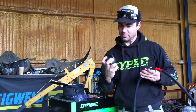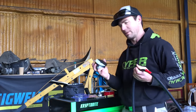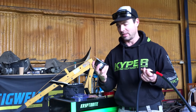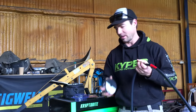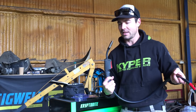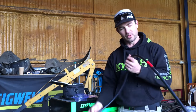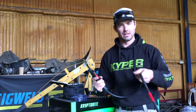I also ran out of wire, so I was using gasless wire and then I've gone back and bought some 0.6 - this is 0.8 and I've gone back and bought the 0.6 mild steel wire. In the process I've lost my 0.6 nozzle, so I'm going to be using 0.6 on a 0.8 nozzle. I don't know if that's going to affect the welding or not, so we'll give it a crack. But first we'll just fix this leak and then get back into the plenum chamber.